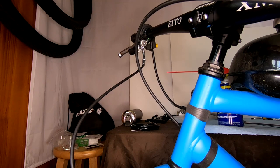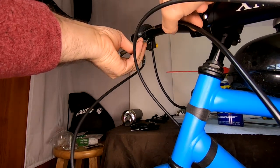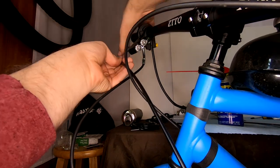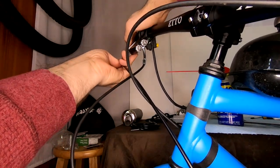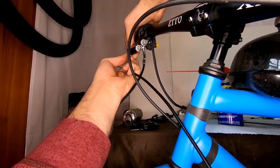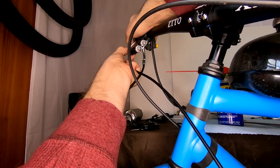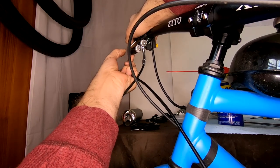Now, as I found out earlier in the year, and most of you were here to see it, I don't recommend using dual brake levers for bikes that are built for speed or for bikes that are going to hit the trails. I still use them, but I accept their limitations. You don't have as much control over the bike when you're trying to brake with both tires under equal force.